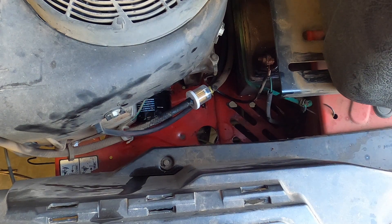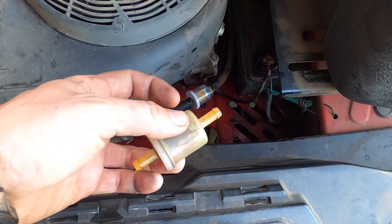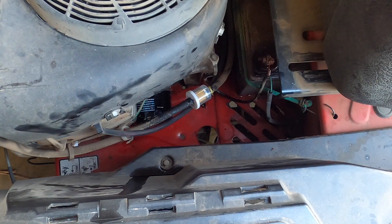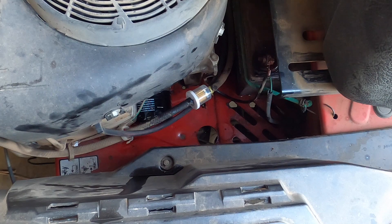Another thing — three important things right now. Contrary to some people's popular belief, fuel filters are indeed directional — they're kind of like performance tires. Here's a dirty one to show you better: see that arrow? Follow that arrow — fuel goes that way. It's almost always that way, but just in case you were ever confused, the open end of the filter is where the fuel comes in and the paper filter is where it gets sucked through.